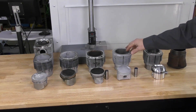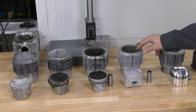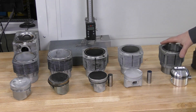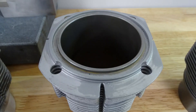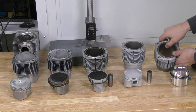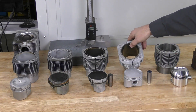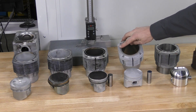Biral cylinders have a cast iron insert and an aluminum fin arrangement on the outside. The next set is used on the 2.2-liter and 2.4-liter engines and will typically be a biral design. You can also see the differences in the head gasket surface: the 2-liter barrels use a composite head gasket, whereas the 2.2, 2.4, and 2.7-liters use a CE ring that sits in a groove.